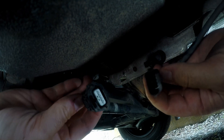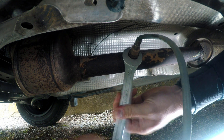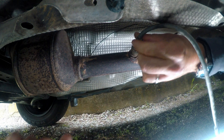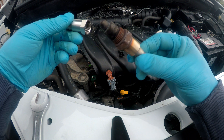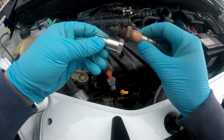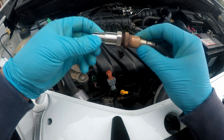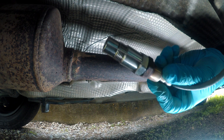Make sure to subscribe. It's time to unscrew the O2 sensor — sometimes they are extremely rusty, so be careful. And here it is, the downstream O2 sensor itself. It fits in the adapter nicely. Product links are in description below. The thread is M18x1.5 and, like the O2 sensor, you can tighten it with a 22mm spanner.